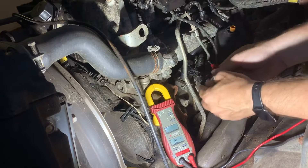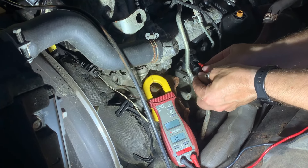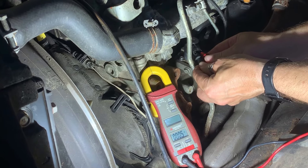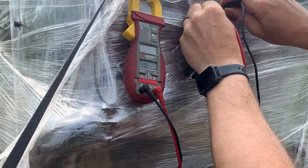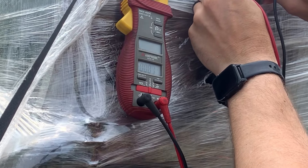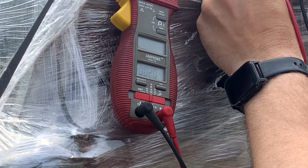Now that I have this engine here, there's something pretty easy I'm going to try. Someone made a comment on one of my videos to verify that the solenoid is actually operational, because if this solenoid isn't opening, the fuel's not going to go anywhere. And that's a pretty easy thing to check. First, I'm going to check the resistance of the coil — if it's an open circuit, it's likely the problem. Looks like we have about three ohms. Let's compare that to the one on the parts engine — and it's three ohms as well. So the resistance on both of them matches, but there could be a mechanical issue inside. Since it's only two small screws to remove it, I might as well give it a shot.